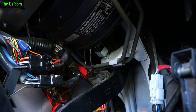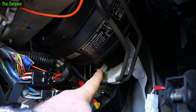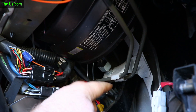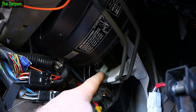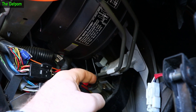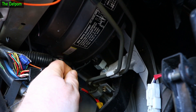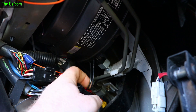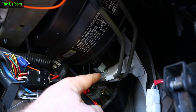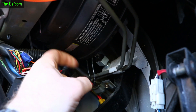I found out why. Here's the brake pedal, and just here is the switch. When you push the brake down, the switch operates and it closes the contact between these two wires here, and that turns on your brake lights. I did some investigation and it turns out this doesn't work anymore — it's only constantly open. When you push the brake pedal down, the plunger doesn't extend and the switch doesn't close. So it also means you've got no brake lights. Not good.